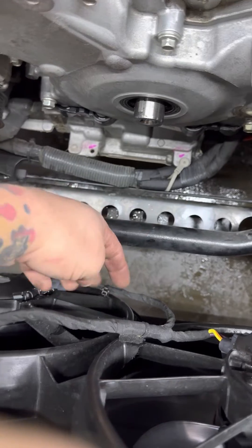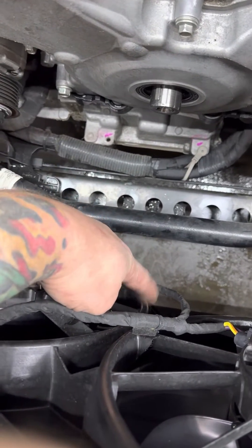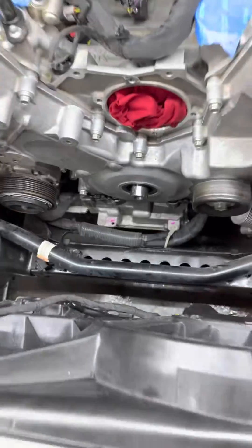The other problem you've got with pullers is you've got to have enough room to get all that in there and still tighten it. The head of the puller was right against the plastic on the fan — it's a pain. Make sure you've got plenty of stuff ready. I was expecting to knock this out no problem, and two and a half to three hours later of trying to find parts and round up stuff, here we are — but it's off. Just make sure you're prepared.